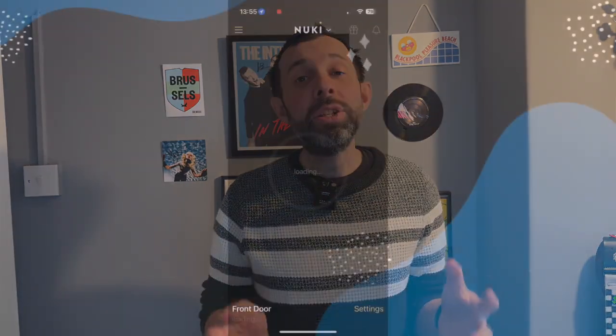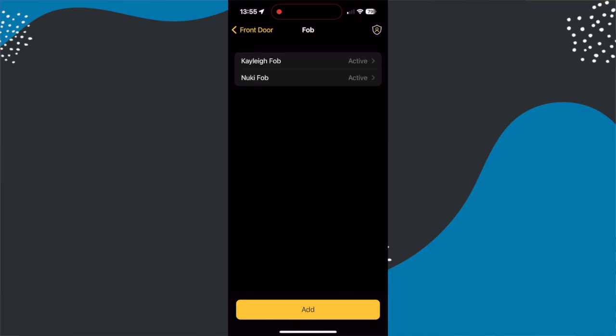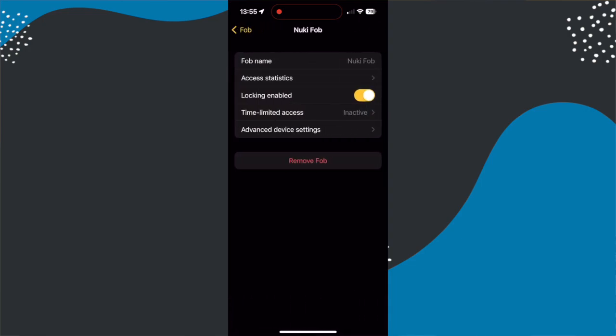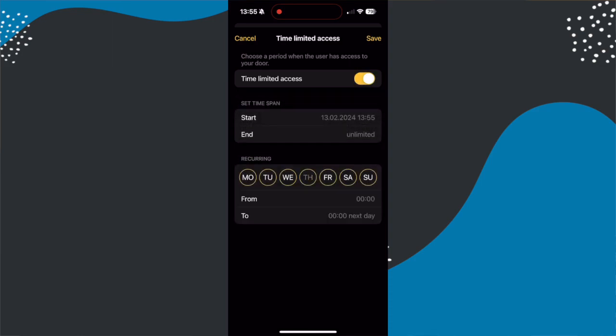So let's talk about setup — this is easy as well. To set it up you first hold down the button on your Nuki device for 5 seconds to put it into pairing mode. You then do the same thing with the button on your FOB. When the lights on your respective devices stop flashing, it's paired. You can then go into your Nuki lock on your smartphone and view that key fob there, rename it, and set any restrictions you want. You can also go into advanced options and configure how the FOB works, and of course remove it from there as well. It's a really simple process and it works well.